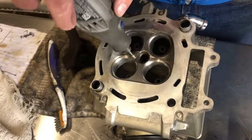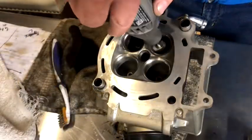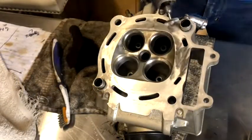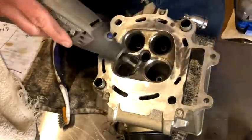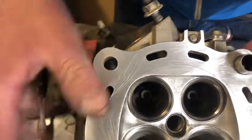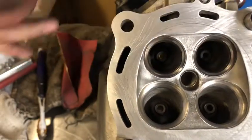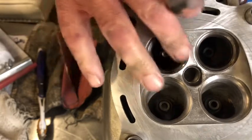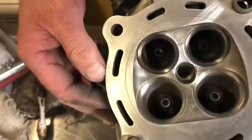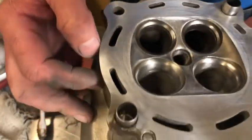I got a little close to the valve seat, but at any rate I had the intake valve seats machined on this head and used the Dremel tool to clean it up. Here you can see the two intake valves and the two exhaust valves, and you can see the seat condition a little better now. We will reinstall those valves and see just how well they sit down in that seat.